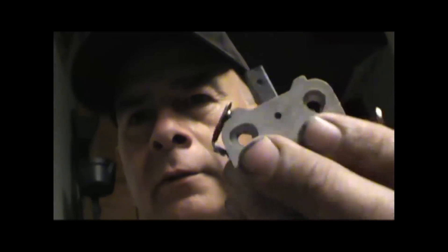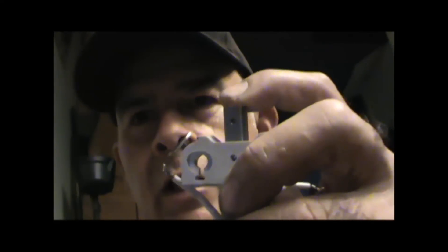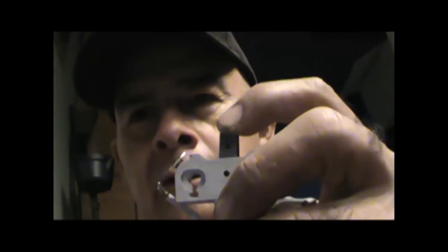This is for those who don't know a whole lot about alternators — sometimes your alternator may go out and you don't know why. It's spinning but it's not charging your battery. Well, it could be that the brushes wore out. This is an alternator brush repair kit — it's like eight bucks, that's all it is. These are the brushes right here. They stick out and press against the moving parts in the alternator.